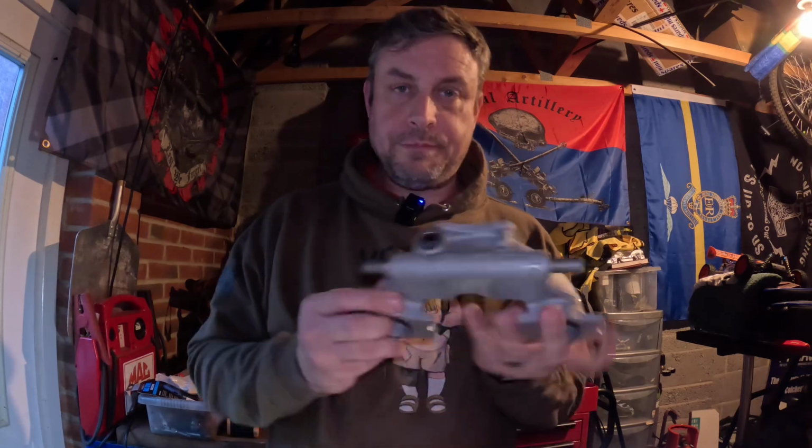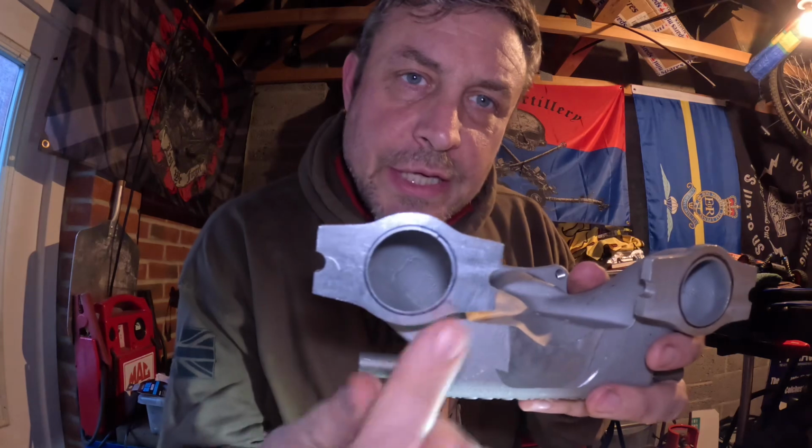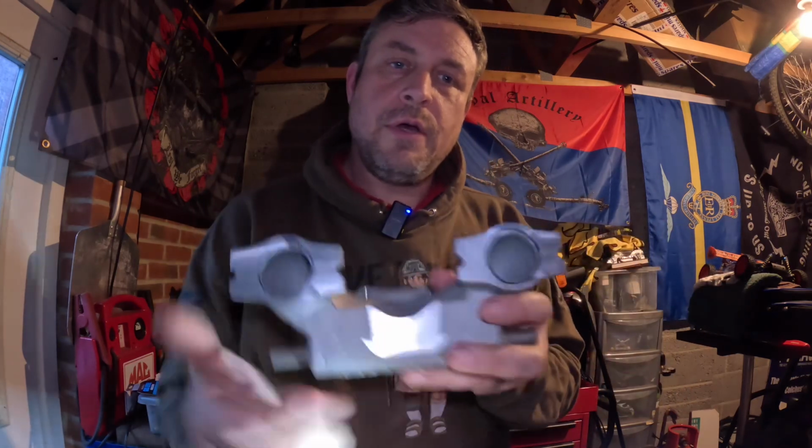Okay, so bit of a change of plan. As I was tidying up, I said, find something to do to move the Mini along. What I have just found is this Mini spares cast inlet. What I have done, if you can see on there, I'm just going to open it up a bit. Better flow. Okay, so this is cast aluminium. So going to use my Dremel, other multi-tools available. Just going to open that up, see if we can get in there, smooth up some of the casting marks. And yeah, that's what we're going to do now.